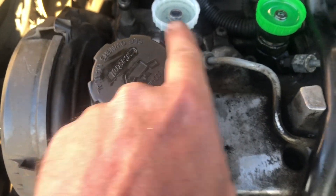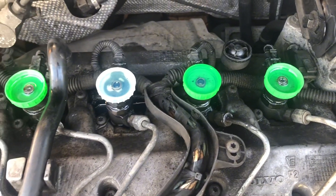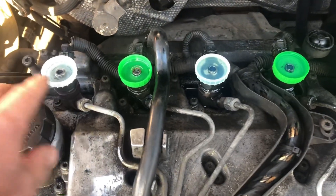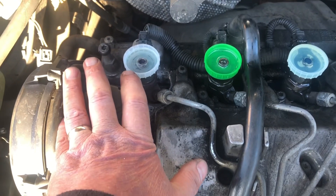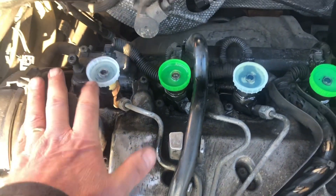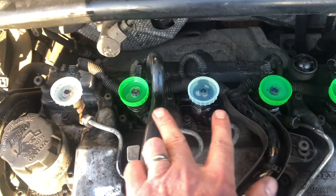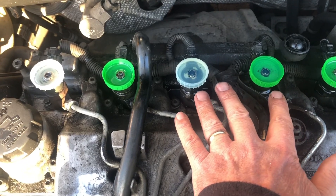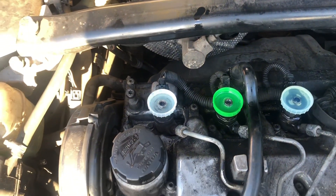So that's two injectors I'm potentially going to have to replace. The other three seem about right. The test took in the region of 30 seconds and it was surprisingly fast. These caps, before we drilled holes in them, had a capacity of 11 millilitres and are taken from 2-litre milk cartons. I now know we're having at least two injectors replaced in this vehicle.